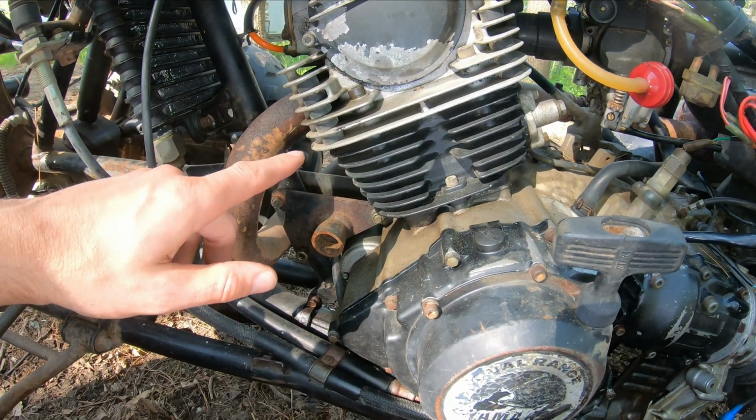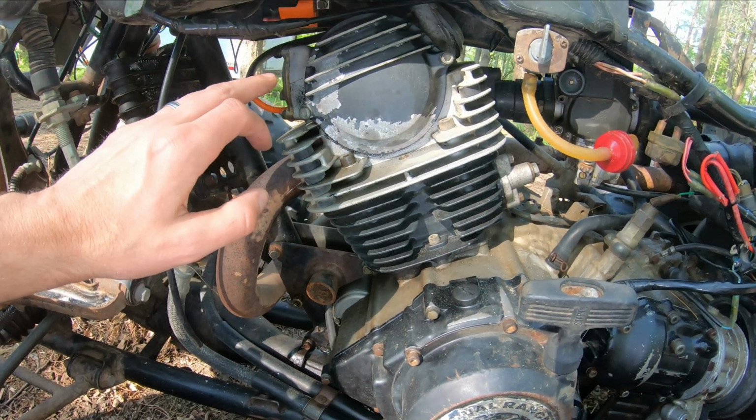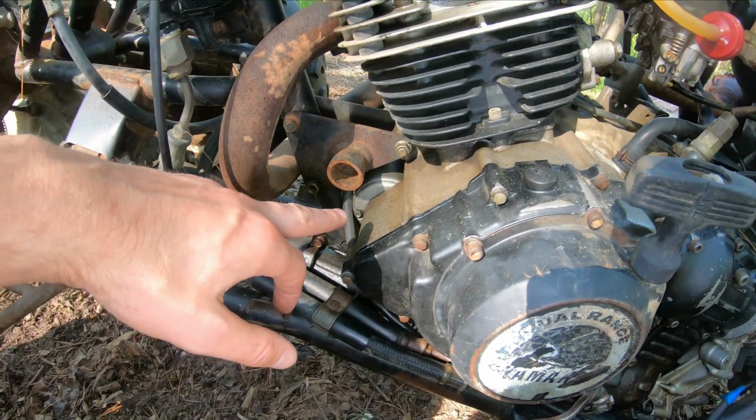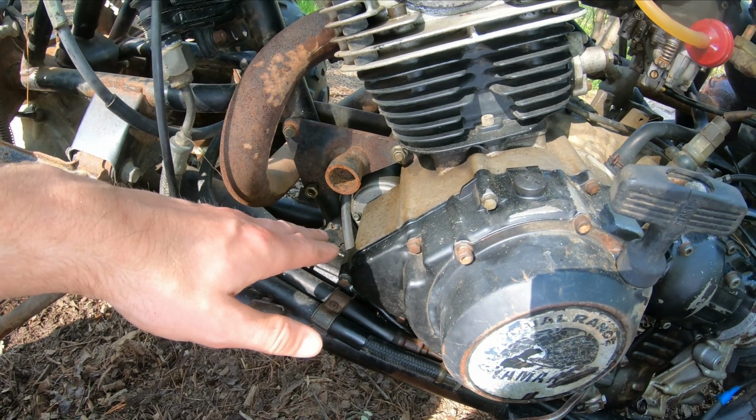So I can hear the centrifugal clutch on the other side spin down. There's ticking going on up here. Could be valves smacking. I don't know. When I was starting it, there's a pretty loud clunk that came out down here around the starter. Also don't know about that.